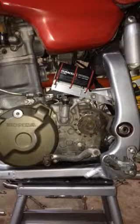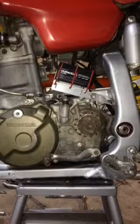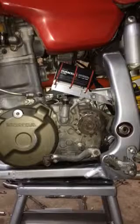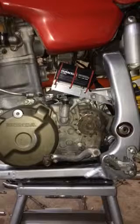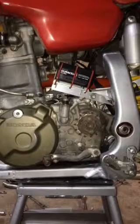Basically all I did was took a 1 inch piece of C channel and tied into the cross bolt. There you see the head sticking through. That bolt goes all the way through the engine and through to a tab on the other side, so it's a good anchoring point. Basically just drilled that hole in the C channel, and I notched it on the rear — which you can see here — to clear that weld so it would fit up nice and snug.